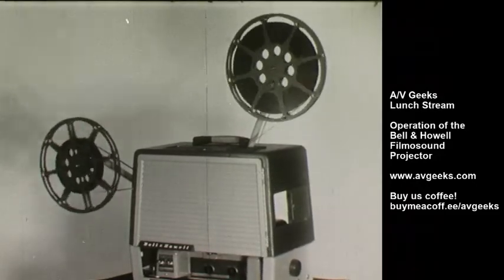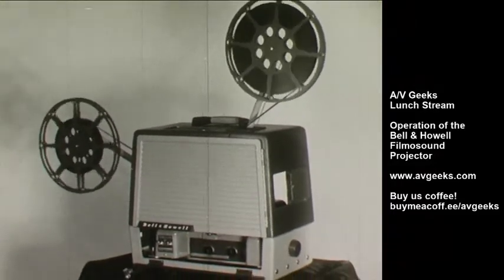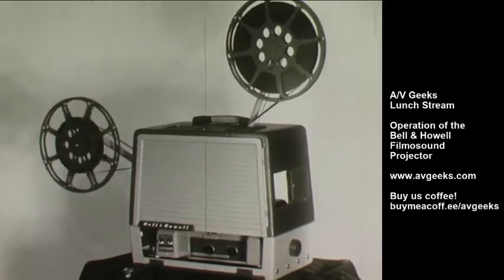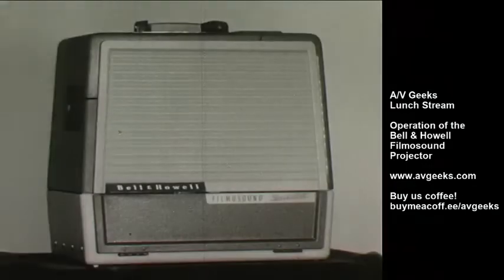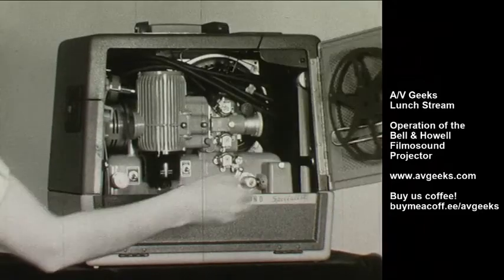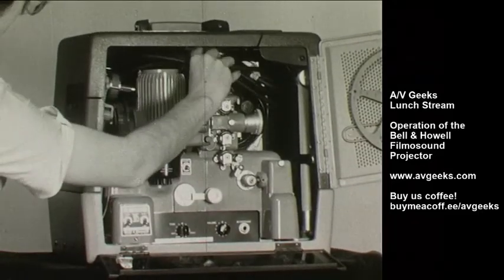This film was produced to aid projectionists and describes the proper use and essential care of the Bell & Howell Filmosound projector. The operation of all the Filmosound models is practically the same. With the projector placed on the projector stand opposite the screen, the two doors on the right side should be opened. Remove the power cord.